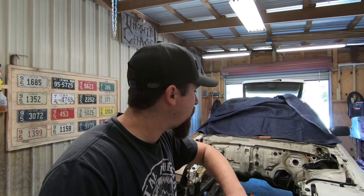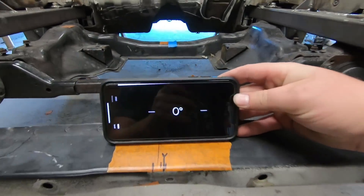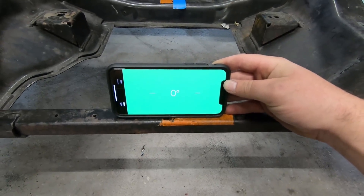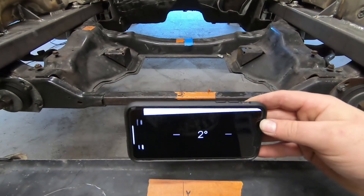That's all good — out of our way. There are no other mounts in here that we won't be using; all we have is the mounts on the subframe. Now, I know a couple seconds ago it might have looked a little crazy to cut everything down. But there was another issue — it wasn't only over too far by about a sixteenth to an eighth of an inch; it also wasn't sitting perfectly level with the rest of the car. Right here we have the radiator support zeroed out, then this piece zeroed out, and the back of it zeroed out. This piece, that piece, and that piece are all completely parallel.